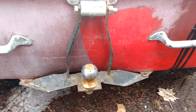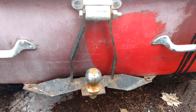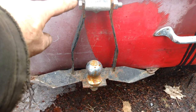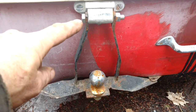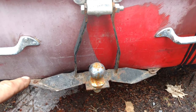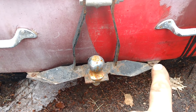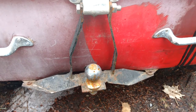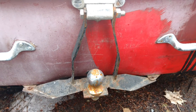Here is the back of one of my Penguins. This one does have a trailer hitch installed, so I'm going to have to remove the trailer hitch to install the tow bar. I need to remove the bolt at the top and hang onto it because I'll need it to install the tow bar, and then remove the pin with the cotter pin and take this hitch off. Then we'll put the tow bar on.